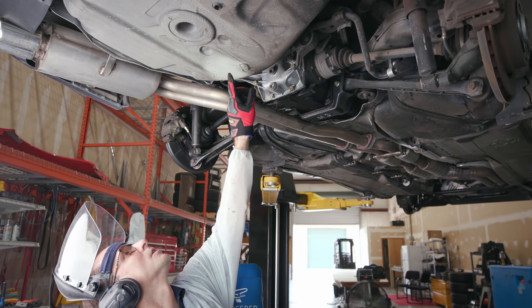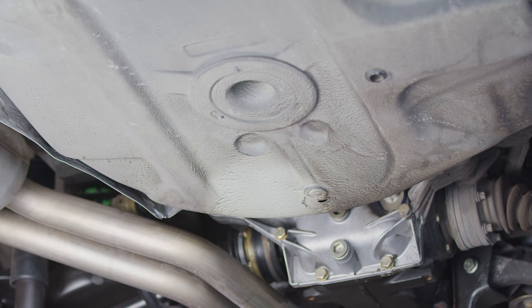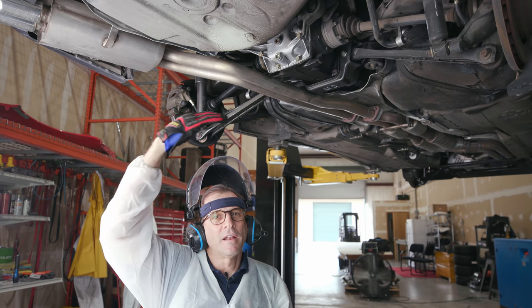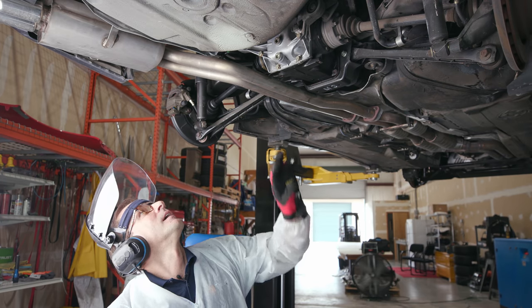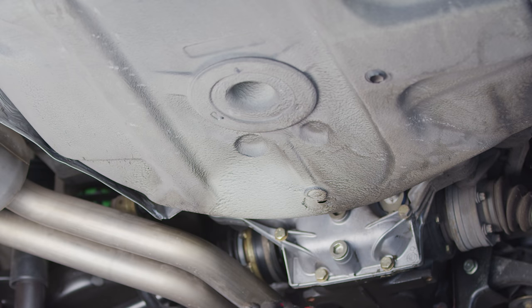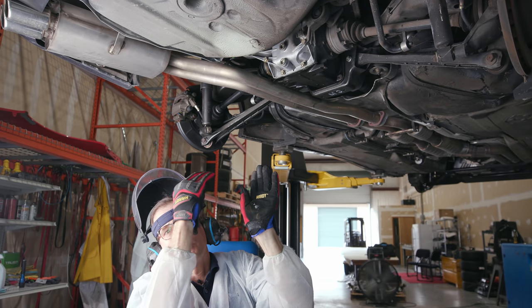This is pretty cool. This is really getting into the weeds, but when the robot sprays this car, there's techno violet drift that's coming in under this car. And if you look closely, you can see these dark lines basically on the high ridges of the small little mountaintops of texture. And that paint is stuck to those high ridges.